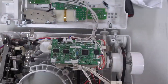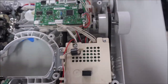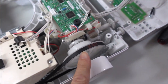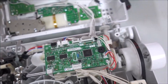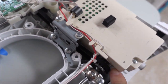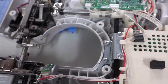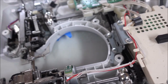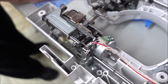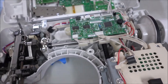Looking at the components: there are two shafts - a shaft on top and a shaft on bottom. There's a motor over here that drives this main gear, which drives the top shaft, and an interconnecting belt that connects to the bottom. These two are synchronized and in a certain position - you've got to maintain that timing and synchronization. This controls the needle up and down; this controls the bobbin position.